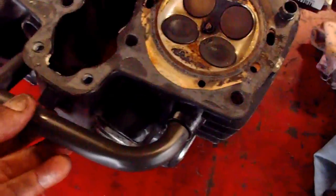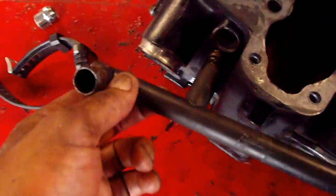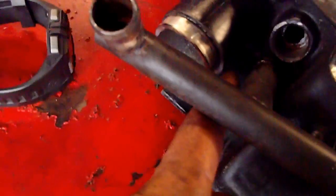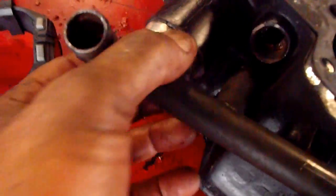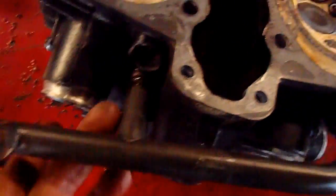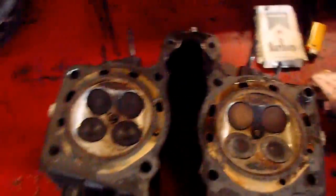One of the keys - the only way this thing was going to work was I had to pop this free. The way the oil line, which fastens right there, the oil line wouldn't allow this thing to drop enough to clear the carburetors. So I had to pull this back just a little bit and then there was clearance and then the whole thing popped out.